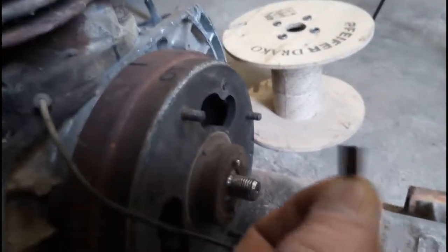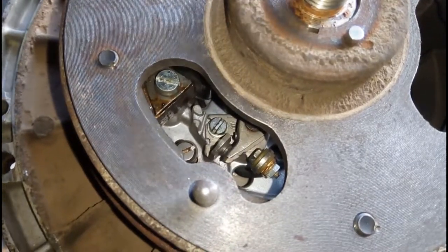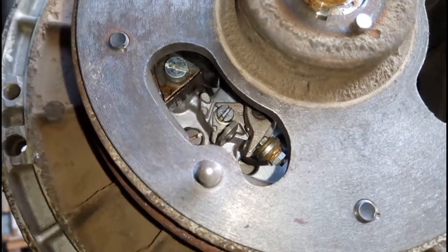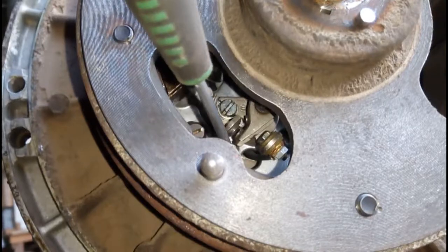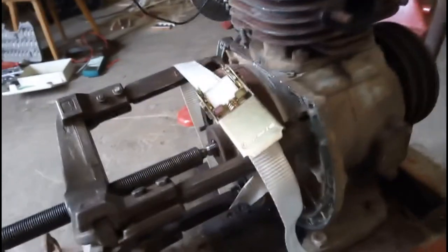After that I shut it down and suddenly there was no ignition anymore. I found this little component had come loose inside the ignition system. These contacts are meant to be pushed together by a spring that came loose, and only open for a short period of time at a preset point — that's when the spark plug ignites. I managed to get it on there somehow, but the legs would always jump off the edge, so I put a ratchet strap around there and that seemed to do the trick.